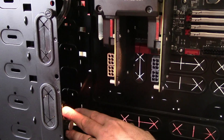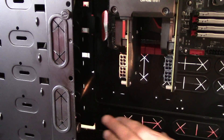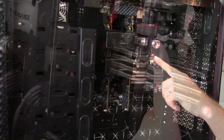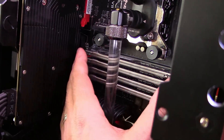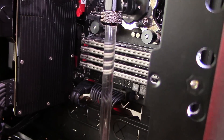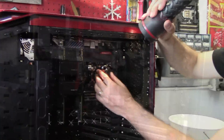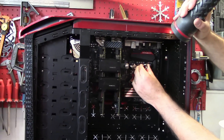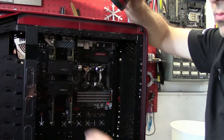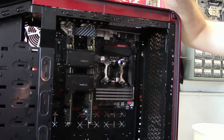Nice and clean. Up from the bottom, the 360 radiator feeds into here. The reason why this is at this height is so the pipe clears the DDR if you have to take the DDR out. From there, we've got a snake on the water block going to the GPU so you can get a straight shot, and then from here back into the reservoir. Nice and clean and simple.